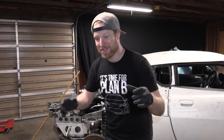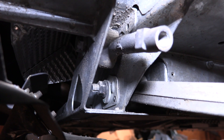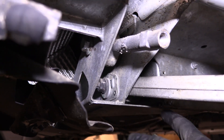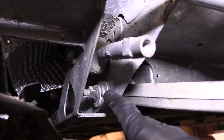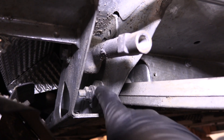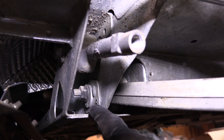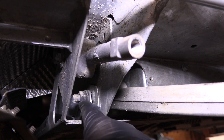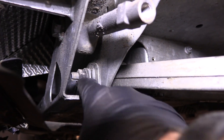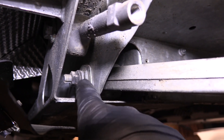Good news — I'm going to bring you down there and show you what I found. This is going to be really hard to film — small spaces. But this is our lower control arm leading back here; this is the mounting point to the subframe. The subframe is definitely not bent. If you can see this little piece of metal here — I don't know if it's aluminum — it's riveted to the subframe and it's like a spacer. Then you have what's kind of like a camber bolt right here. It leaves room for this bolt to slide up and down and move a little bit. On the back side of it, this plate is smashed up and this bolt has shot too far back that way. So this little plate is damaged.